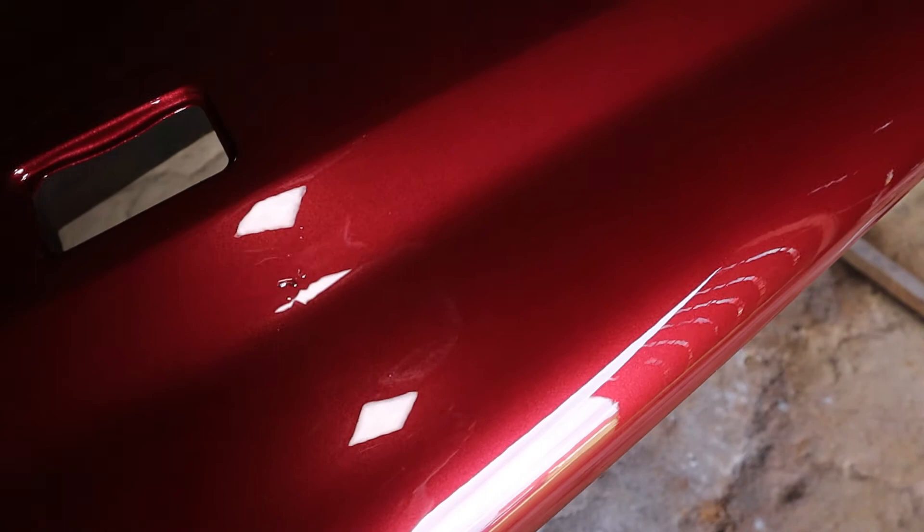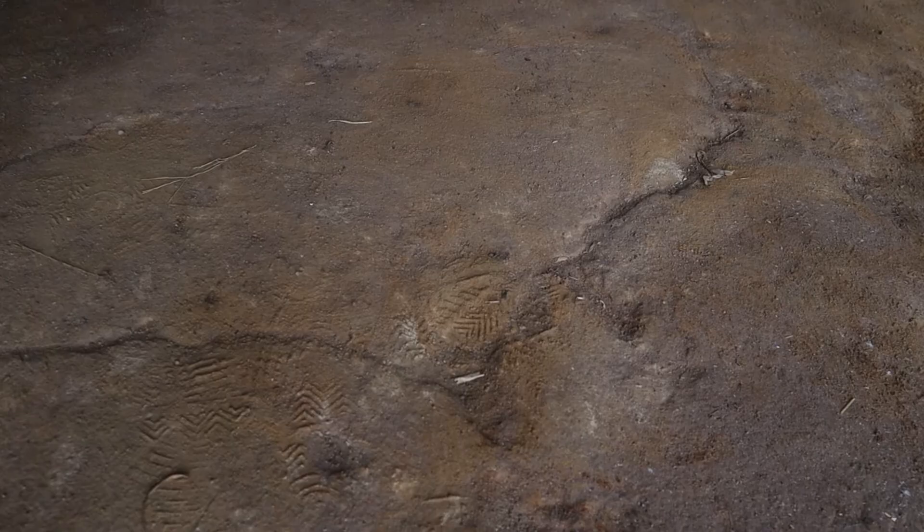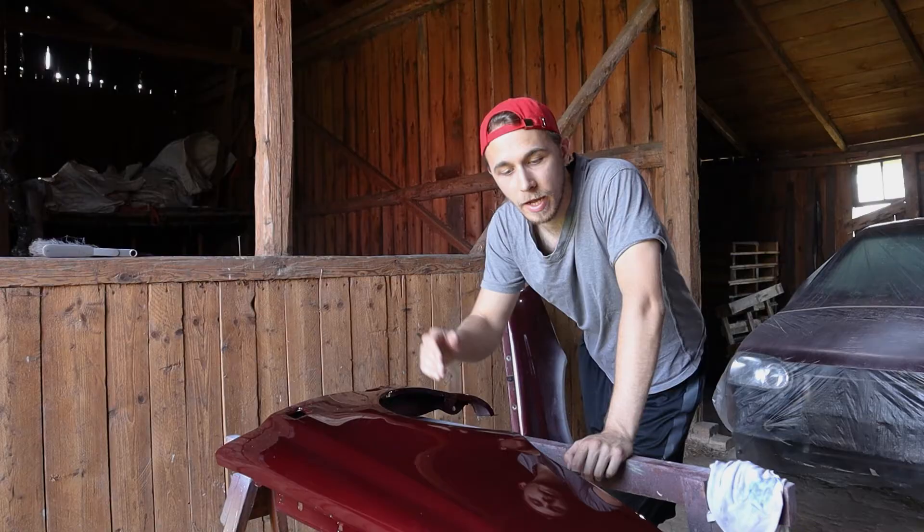The clear coat clip was really short because the clear coat oversprays like crazy — it atomizes hugely and I didn't want to destroy my camera. But it's not that bad, to be honest. There are downsides to painting in this environment — a couple of hairs and dust — but considering I'm literally painting on dirt, it's very good. I put four coats of clear on this because I knew I'd get some dust, so I wanted an extra layer to wet sand and then polish. I'm going to start with 800 grit sandpaper and go finer.